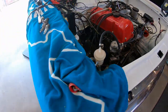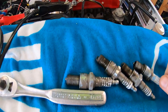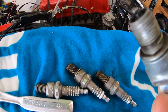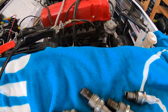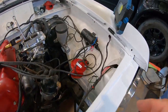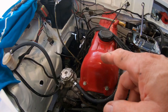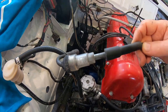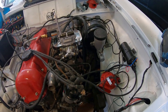I've been cranking it over — I got a gallon of gas in the tank. I got all the plugs out and the coil disconnected. I was hoping the pump would work and pump some gas. The compression is 30, 120, 120, 135 — first cylinder is pretty low. The plugs are pretty nasty, all covered in paint, but they don't look worn out. I'm waiting for a new 3-ohm coil — this one is a 2-ohm which is supposedly the wrong one. I did see spark though.